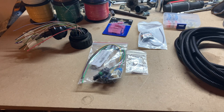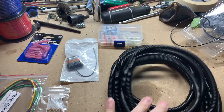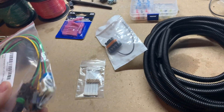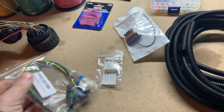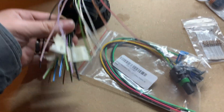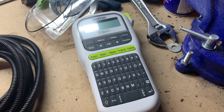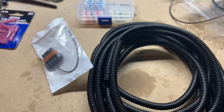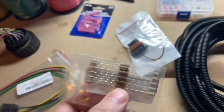A couple of things: first, we're going to run the alternator cable — the Holley Terminator X doesn't actually come with one, you have to make your own. I got some loom here to shield it. This is the actual plug I got from ICT Billet — really from Amazon — I'll put the link in the description. I also got a three-pack of a vehicle speed sensor, reverse lockout sensor, and a reverse light switch. For the alternator, you need a resistor — a 150 ohm, half watt resistor — you have to put it in-line between where you're running it from the harness to the actual plug going into the alternator.